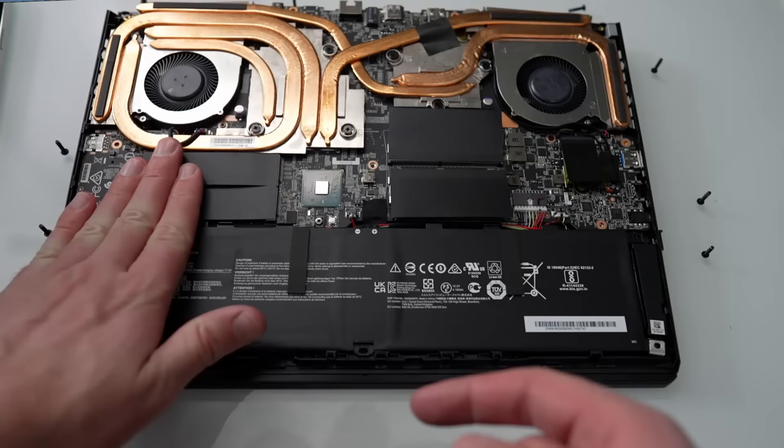Now, it's really nice that MSI lets you do a lot of advanced things to the CPU. You can actually unlock it, do tons of tweaking. You can tweak your memory timings, and you can overclock the CPU. Even though this is an 11800H, it's not an HK processor, but you can still set the clock ratios in Intel XTU. You can raise and lower the power limits, and you can undervolt the CPU. But here's the thing, because the CPU only has two heat pipes, you're going to be thermally throttled and power throttled pretty quickly, no matter what you do. Undervolting will help, but this definitely doesn't show us the true potential of the 11th gen Intel CPUs yet.